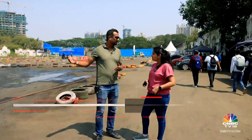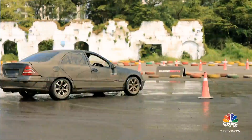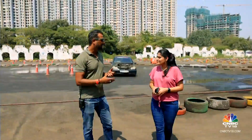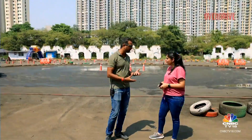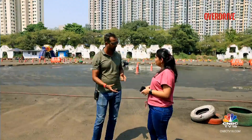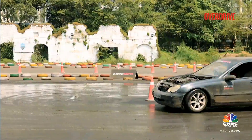We found cars like these — old C200s. This one is a W203, a 2004 model, and these are manual. Being manual helps you drift better. We modified these cars: the differential is welded, we have a shortened pulley, we've reduced the weight — a lot of things done to make it more powerful and able to drift.